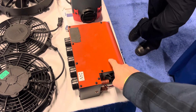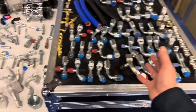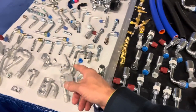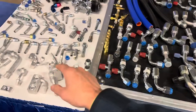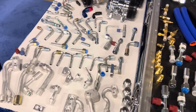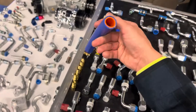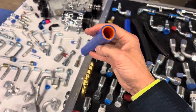Whatever you want to do, I recommend using steel — it's a little more durable. If you're in a saltwater environment, never put steel next to aluminum. If it's going to be exposed to high vibration, use steel. Use aluminum on the mild stuff, just be careful. And it looks like they've got some fancy silicone heater hose — you hot rodder guys will want that.